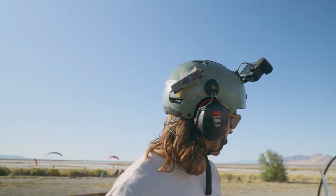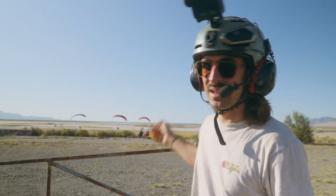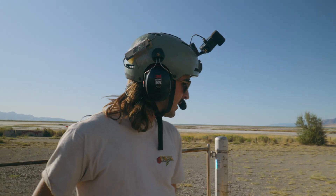I just spent the past hour tuning the motor. I had to go from the 128 jet to the 126. There's still a lot of tuning to do, but I want to shout out my buddy Brad Roper - he flies the Polinis pretty much exclusively and had all the information I needed to get this thing tuned correctly. Because we're at 4,000 feet altitude, it's running a little bit too rich so it might not make full throttle, but this is going to be my first test. We're out here at the Great Salt Air with our students. I'm going to take you up on the Polini.